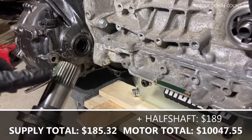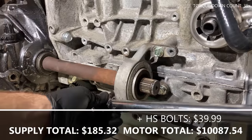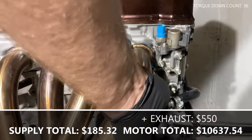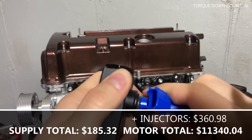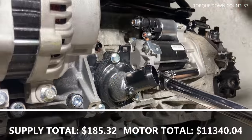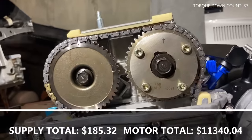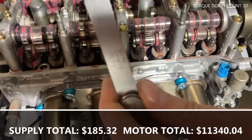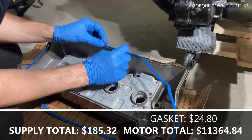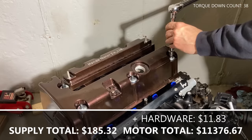Place some high temp urea grease on the spline on the half shaft. Tap it into place and torque down the bracket. Install the exhaust headers with the gasket and torque it to spec. Take the fuel rail, install the injectors, place the injectors into the ports and torque it to spec. Torque the starter to the required spec. Orient your cams using the markings on the gears to top dead center on the cylinder you're working on. Take a feeler gauge, measure the valve lash, and adjust it if it's out of spec. Install the gasket to the valve cover, apply Honda Bond to the recommended surface, and torque down the cover in the recommended sequence.